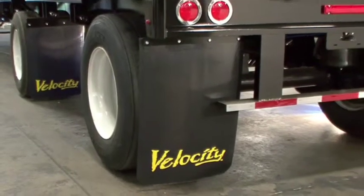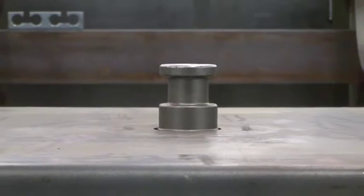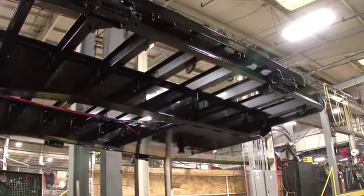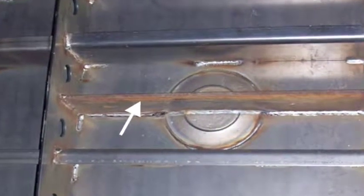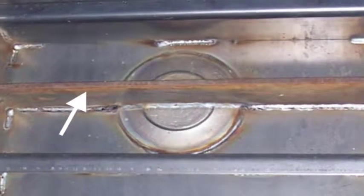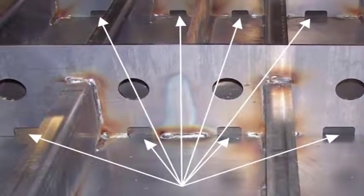The Velocity air ride spread axle trailer comes standard with two sets of mud flaps providing maximum protection and safety. The strength, design, and durability of the trailer kingpin, kingpin plate, and upper coupler nest is the most critical part of a semi trailer since this is the only connection point between a truck and fully loaded trailer. In addition to fully welding the kingpin to the kingpin plate, an additional heavy-duty longitudinal support plate is added above the kingpin and welded in order to provide maximum strength and support. The upper coupler nest and internal supports on the Velocity are designed for exceptional water drainage while minimizing entry of contaminants.